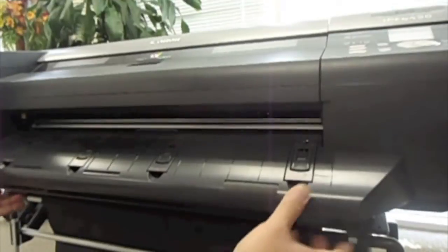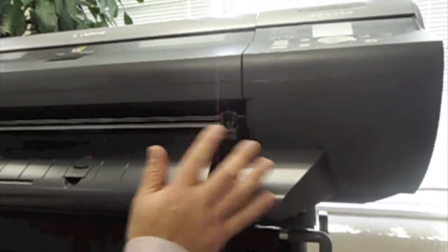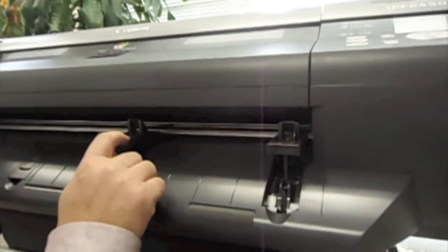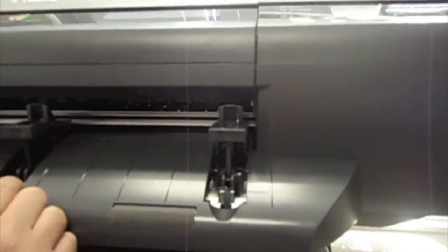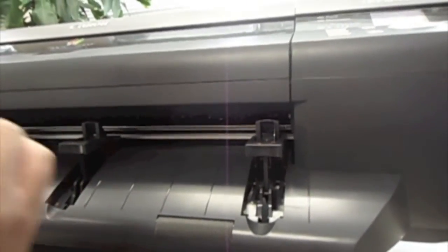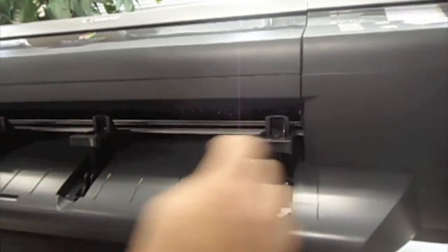maintenance cartridge section, before I remove this front little panel piece off, these little units here pop up like this, and you'll notice there's little orange alignment lines here. So this particular model has the option of taking 2 millimeter thick point of purchase display board, and that can be rigid media, and that's actually fed in the system. So you see these little orange alignment lines.